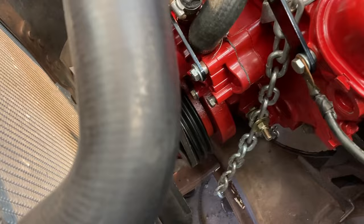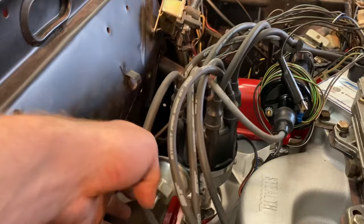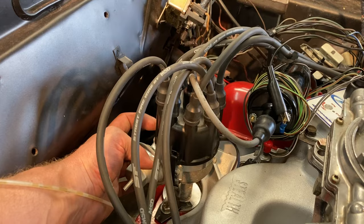I did my spark plug trick — I rolled her back to 10 degrees before top dead center. If you're looking at the distributor and you want to advance the timing, you would go counterclockwise. So if you're ever confused, look for your vacuum advance and it'll be pointing the way to advance it, because what it does is suck or pull the magnetic pickup inside closer to it. I went ahead and set her right back like it was.